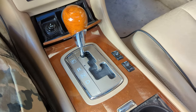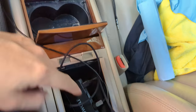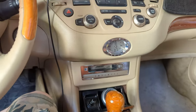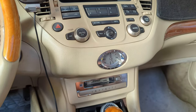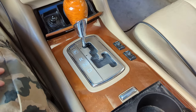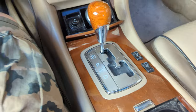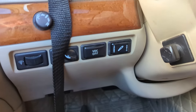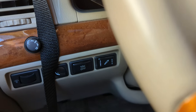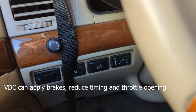The yaw sensor is a little sensor that lives right about here, right underneath this trim. What it does is tell the computer — it's basically like an accelerometer, so it can detect sideways movement and front-to-back movement. If you disable it, it will fully disable VDC and traction control. If you've ever pressed that button, it turns off VDC by about 70%, but if you go around a corner really hard or break the tires loose, you'll feel the computer lowering power.